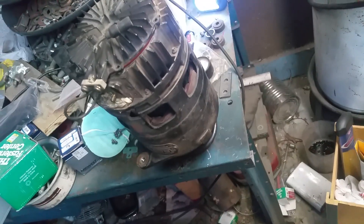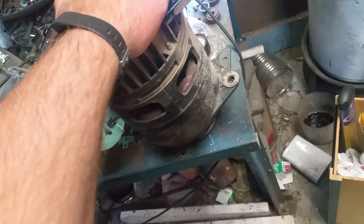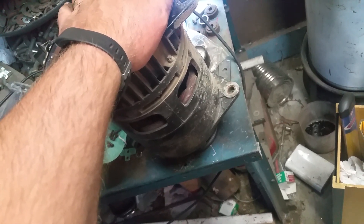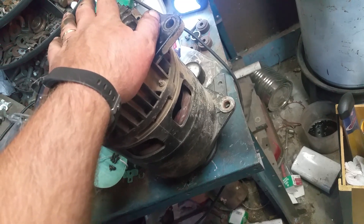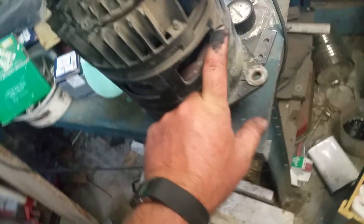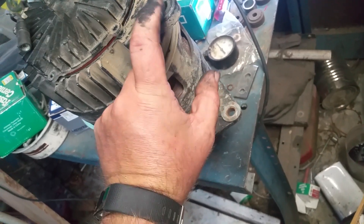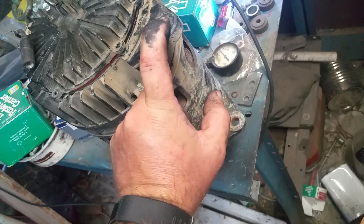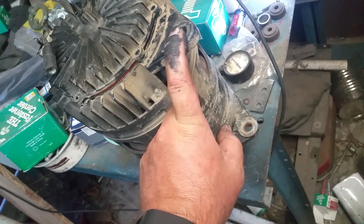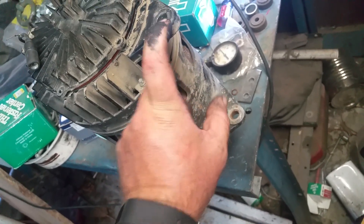Any thought of a simple repair is certainly over and done with. Examining the two of them, the 24-volt cheap generic Delco one-wire clone I picked up — its mounting brackets are only about so far apart. I think I might have ordered the wrong one; I probably could have gotten one with an ear up top. I'm just going to make a spacer, or rather bring it to dad's machine shop to make something that looks nice rather than a chunk of water pump spacer. It should still mount up fine.